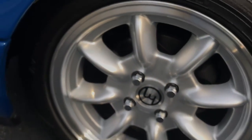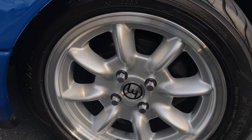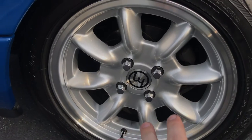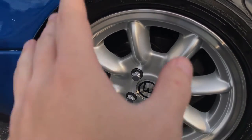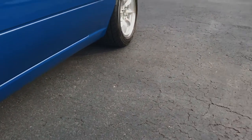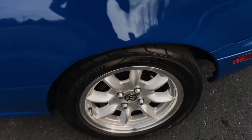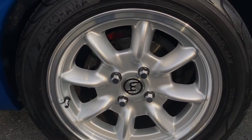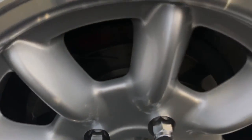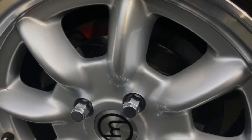The car has its original front suspension mostly — on the driver's side I put the NB lower control arm; the other side is all NA, and they're the same on the jig. I got those from Parts Group. The back is actually all NB now — upper and lowers came from an NB as well as the hubs. The brakes on the rear are still 1.6 brakes with the Green Stuff pads and the slotted DBA rotors.